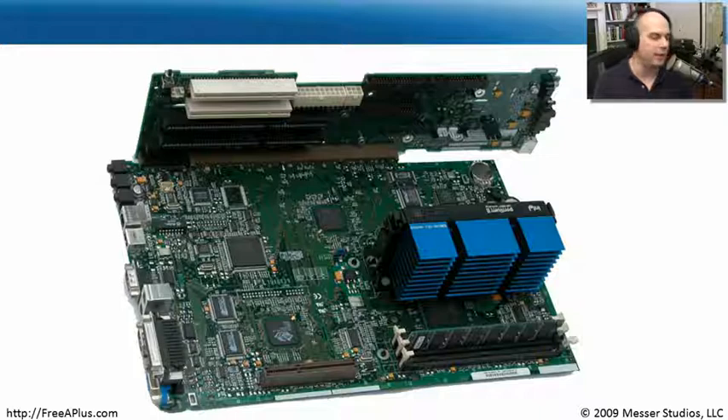You can't do that with ATX, BTX, or MicroATX — with all of those you have to take your expansion cards off and put them into the new motherboard. So again, built for speed. Notice everything flows in one direction from an air perspective, making it very easy to cool. Also notice the accelerated graphics port — the AGP video — which at one time was the thing for video on a system. You could take a very specialized, high-speed graphics card and plug it right into this NLX motherboard. It needed to be really close to the memory and CPU, so it couldn't fit on the expansion card.